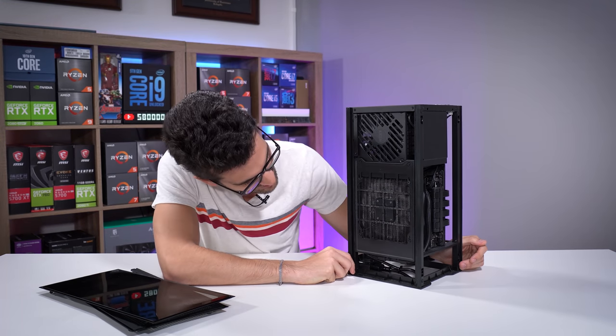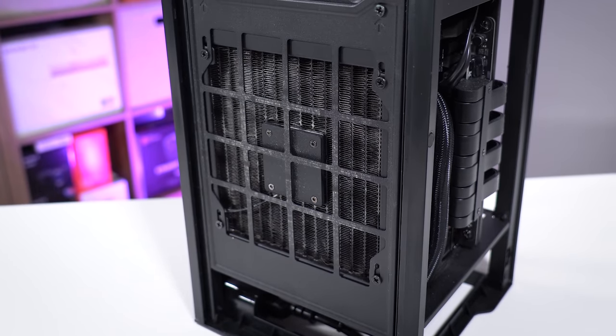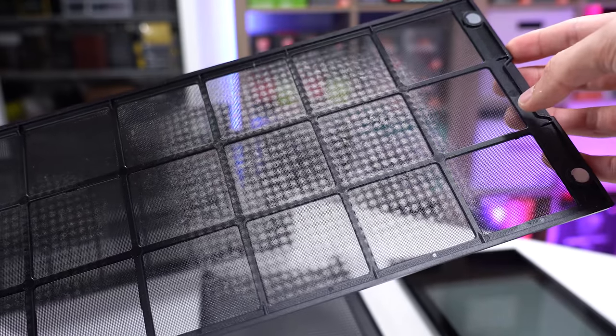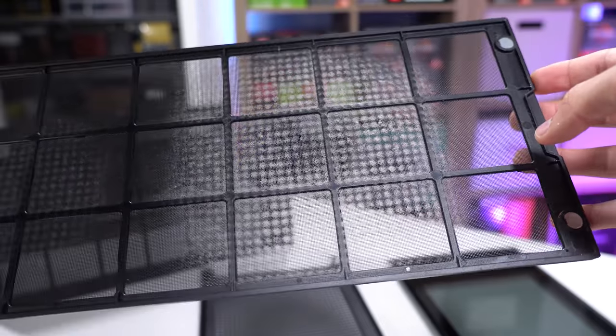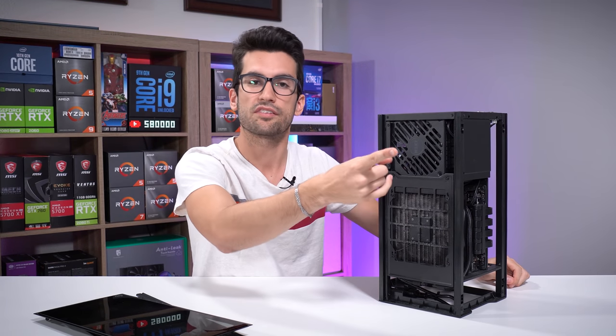I also think we should spend a few minutes cleaning some of the dust that's caked up in this radiator. It's got quite a bit of dust in the dust filter as well — it's pretty gross. We'll clean this all up, swap the screws and the riser with the nylon screws NZXT sent, and make sure everything boots again.